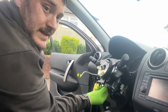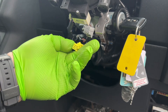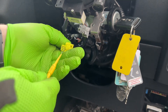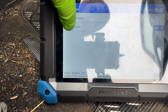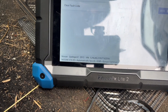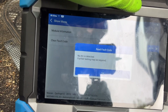There's a yellow plug under here — you want to get to this yellow plug so you can get the decade box plugged into that. We put a wiring diagram up on E3 Technical and found that you need the yellow wire and the yellow and blue wire. So I'm just going to probe into there, set it to the prescribed amount of resistance, clear the codes on the scan tool again — and you can see there are no DTCs there.